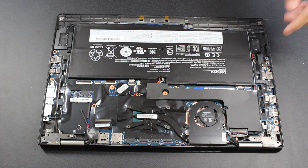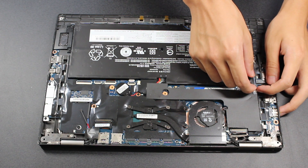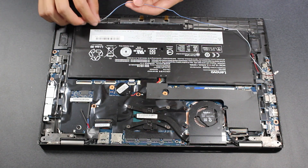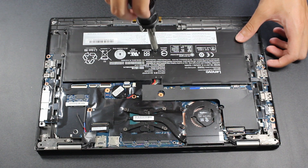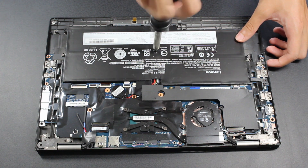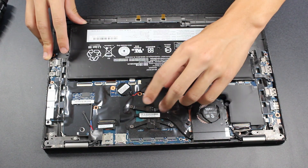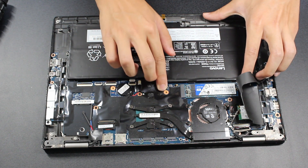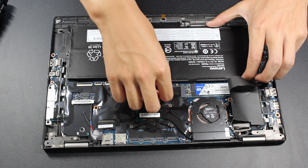To replace the battery, you'll first have to remove the speaker assembly and then remove the battery itself. Begin by unplugging the speaker wire. Then unclip it from the channel by the battery. Unscrew the screws holding the speakers in place and remove them from the chassis. Finally, remove the last screw holding the battery in. Unplug the battery cable and lift it out. To replace the battery, first plug the new one in. As you can see, the battery cable is bent so it can fit in. New batteries may not have bent cables, so you may have to gently bend them yourself.